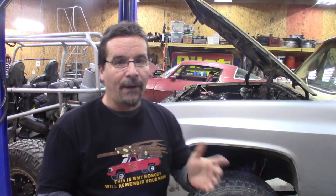Now that may seem a little bit misleading because, as a few of you know, a mechanically injected diesel engine, once it is actually running, you can take the electricity out of the equation. However, for all the other systems in the truck — charging system, cooling, and getting the fuel shutoff solenoid to work with the key — takes a little bit of wiring. It's not complicated at all. I've done some third grade artwork over there on the dry erase board to explain and show in a diagram how everything works.